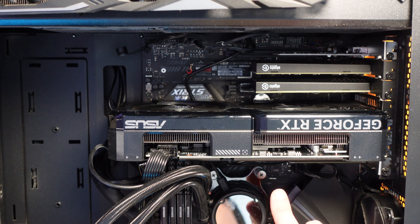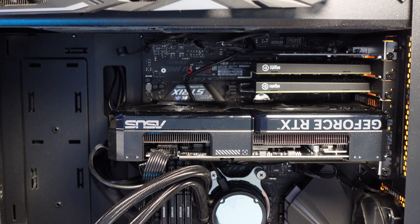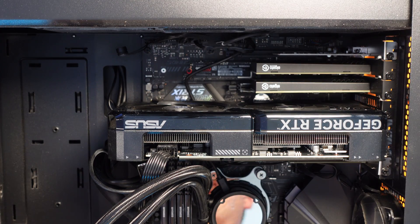Now it's just a case of plugging in the power connectors. It's really important to get the power connector plugged in — if your graphics card has an additional power connector, make sure you plug it in or else the card won't work. I've worked out what the Q and P switch means: Q is quiet mode where the fan won't spin unless needed, and P is performance mode where the fan will always spin even if the GPU isn't particularly hot. I'm going to leave mine on P since this isn't in a bedroom so it doesn't need to be quiet. Graphics card installed!